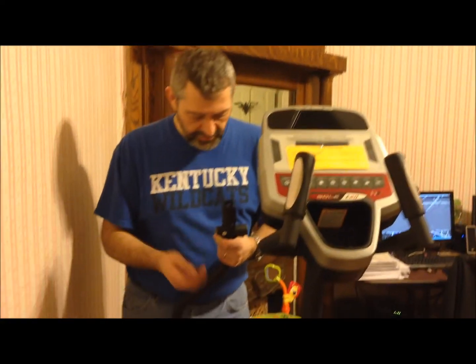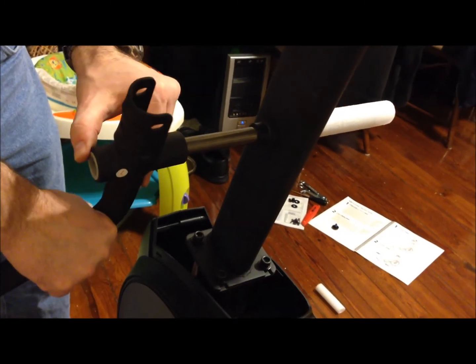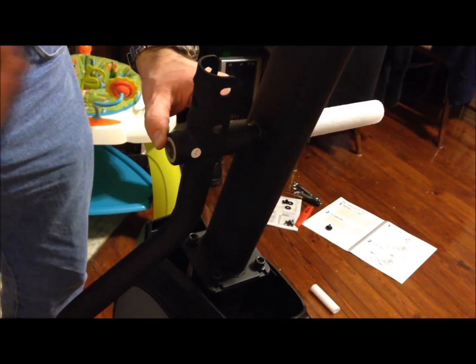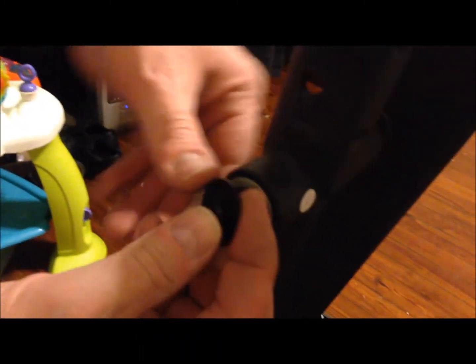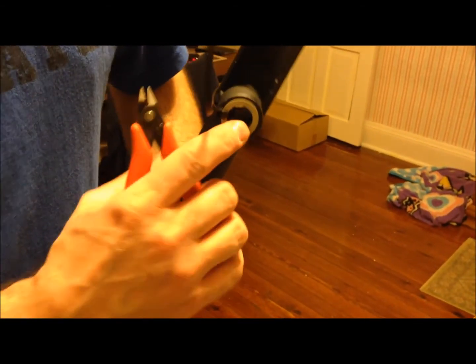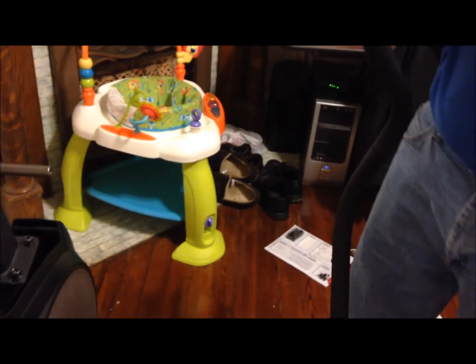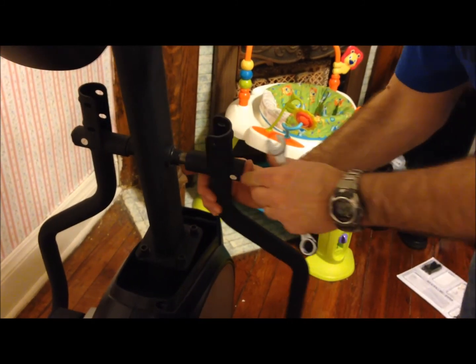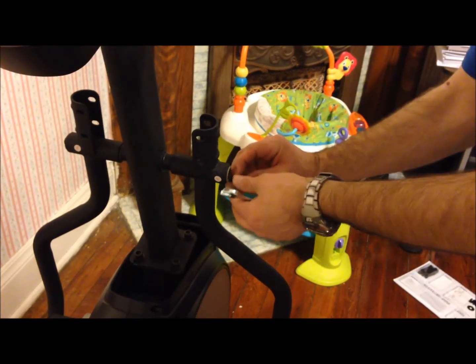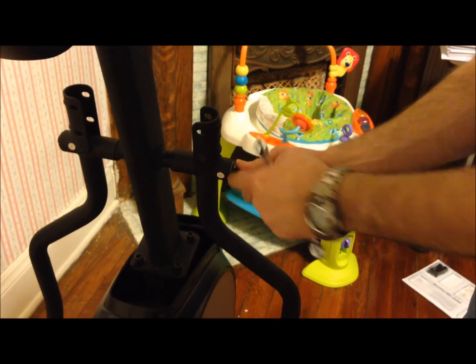The lower swing arm had a little plastic tab in there, so I'll just cut it off. You've got the hex head screw, the bolt, and a washer. I'm guessing those tabs are holding in the little plastic silicone bushings — you just cut them off and take the foam piece off and slide it around. The right goes on the right, the left goes on the left — R is your right. I'm not going to make that mistake again.